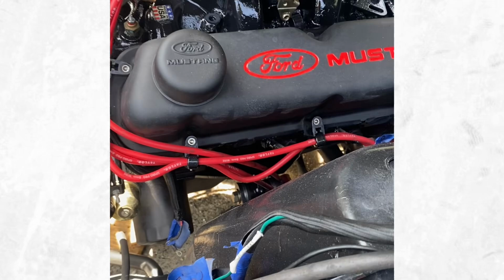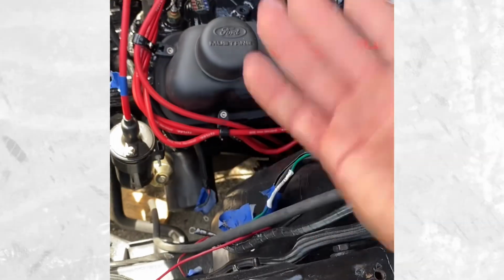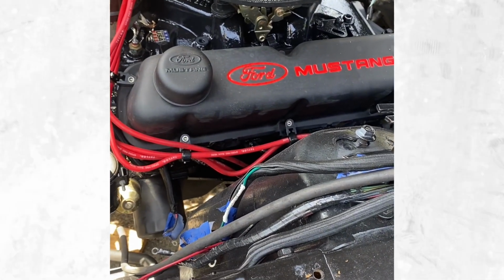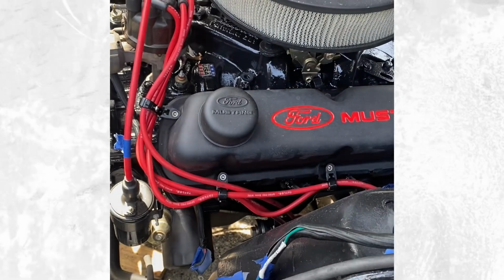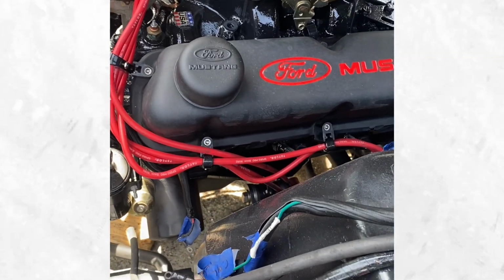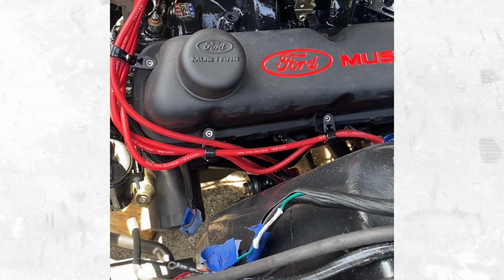I mean, I've already kind of gone over this before. Just gonna take out those two bolts, jack it up, take out these two bolts, see if it works. If it does work, then I will take this one out, support the engine, obviously, hope it doesn't move too much, grab the other one real quick, and switch them. But anyway, that's all, guys. So we will get this taken care of.